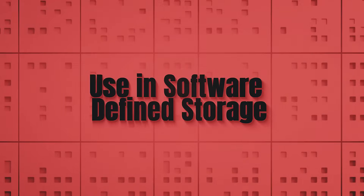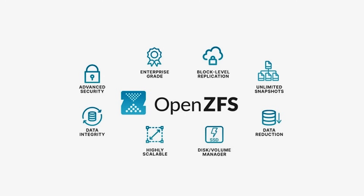That's the hardware overview — hard drives are impressive technology, and HAMR drives even more so. One more plug for Seagate believing in a technology they started 30-plus years ago and seeing it come to fruition. Now let's talk about using them — in software-defined solutions, RAID cards — what are the implications? Can you use them in a Ceph cluster or ZFS array? Short answer: yes. It's not shingled magnetic recording. Performance and power usage are what you'd expect — the only difference is they're bigger drives.